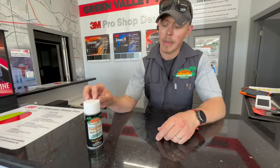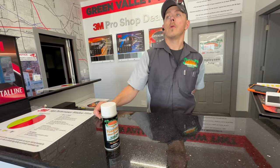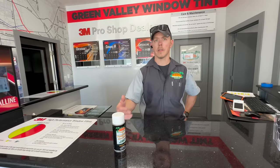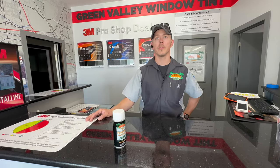If you have any questions at any time, don't hesitate to call us. You might see some haziness, or what looks like dimples in the window. It's just water moisture between the tint and the glass. It's curing. You've got to let it sit outside, let it bake. That will all dissipate. It takes about 4 or 5 business days? Manufacturer standards say 30 to 90 days. That is a nationwide average. When Vegas is at its full peak, 100-something degrees, a couple of days usually does the trick.